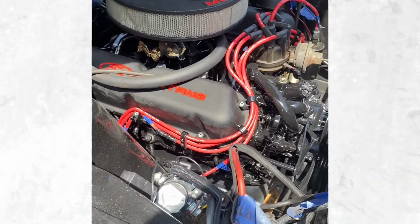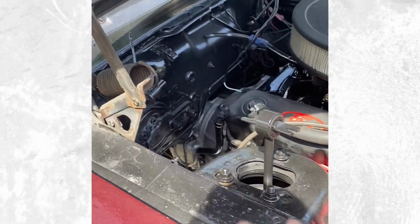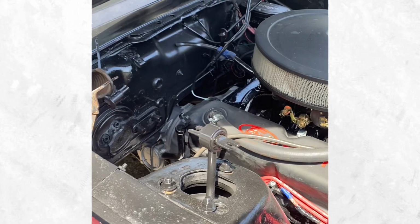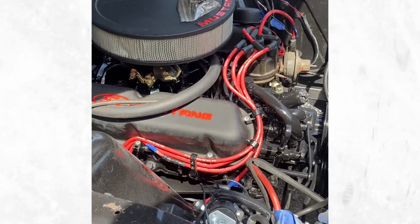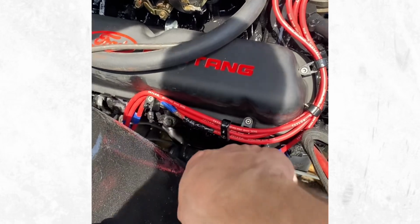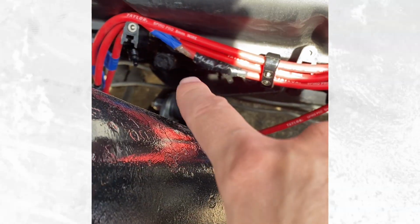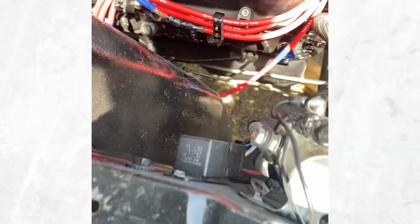We're back, guys. It's a new day. It's been a few days since I've been working on that. Got the transmission hooked up, as you guys previously saw. Anyway, the transmission won't get to the transmission mount. And after doing some research online, I think I installed the motor mounts backwards. So I guess this portion here can be flipped.